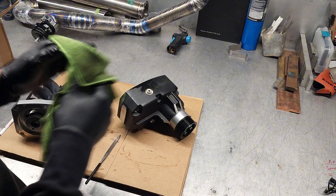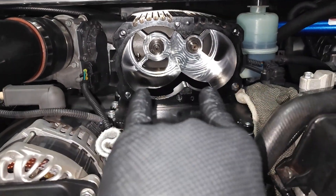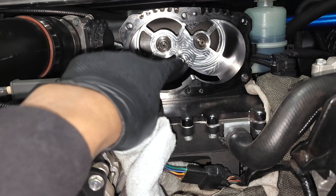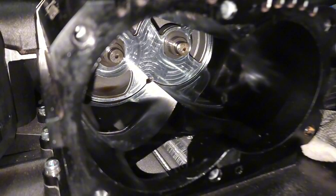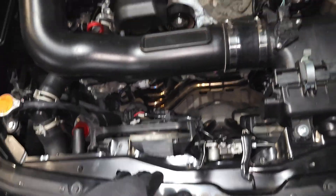We'll clean all this out. That rotor pack we just looked at — those two rotors are going to slide down in there. This is the housing they're going to ride in. The clearance between the housing and that rotor should be as tight as possible without contact, and you can see from in there it looks pretty good. Under there is the intercooler — this has a very fancy high-density intercooler system, with coolant pumped out to a heat exchanger in the front.